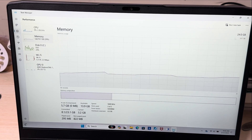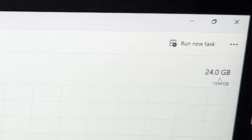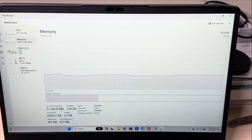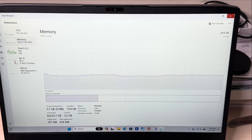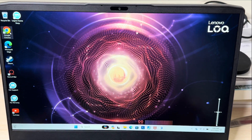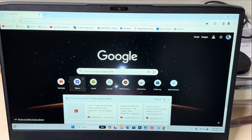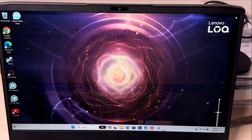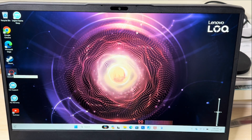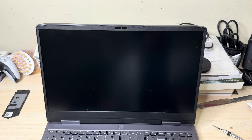And that's pretty much it. You can see right here in the corner — 24GB. I put 16GB in one slot and used the original 8GB, bringing the total to 24GB. It's registered. For a budget laptop, once you upgrade the RAM, this thing's a beast. Everything boots up fast. That's how you upgrade the RAM on the Lenovo LOQ gaming laptop. I hope you enjoyed. Don't forget to subscribe and like the channel — there's more videos coming. Thanks for watching, I really appreciate it.